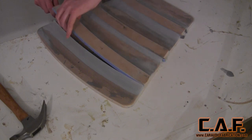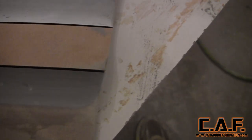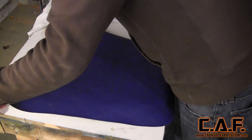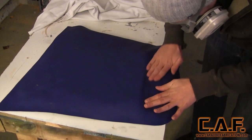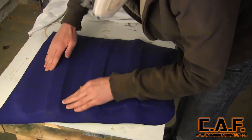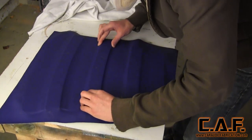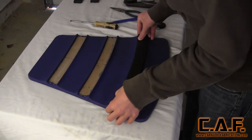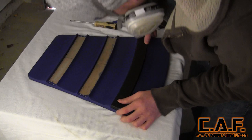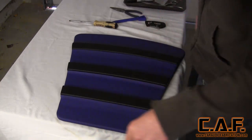Now that the body filler is completely smooth, we'll carefully pry away the inserts, peel off the tape, and as you can see, we have these nice smooth transitions. As I began wrapping this practice panel with vinyl, it became very obvious that these different contours would really show up. In the past all of my contours on a panel like this were the same, but now using these smart spreaders I have a selection of different options. I press in my finished insert pieces to get the full effect, and here we have our finished panel.